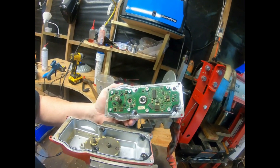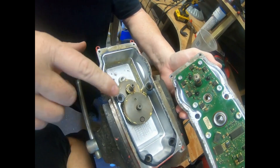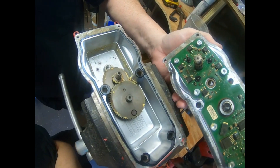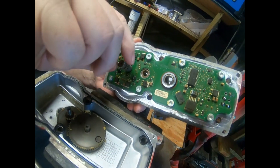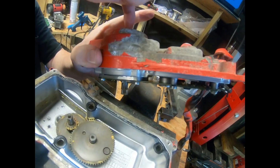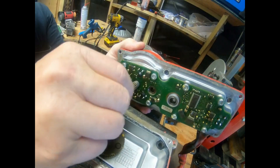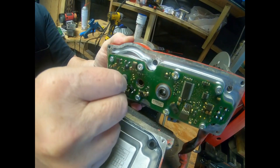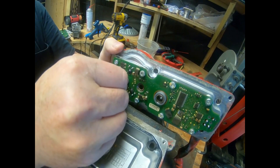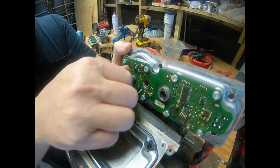You can see the circuit board inside. The bearing looks somewhat okay but the grease is definitely dried up — it's in pretty bad shape, looks like it's got a lot of miles on it. One of the first things I always check is the motor. There's a bearing on the back side and one on the face, and if the back bearing goes bad the motor will have a lot of play in the gear. I'm checking it now — absolutely no play in that gear. It feels really good with just a tiny bit, and it sounds good too.